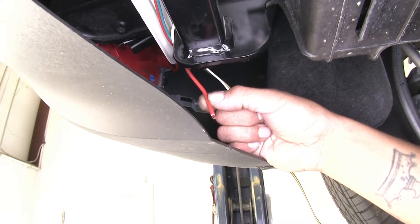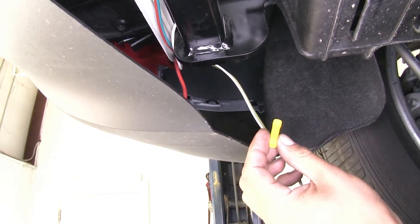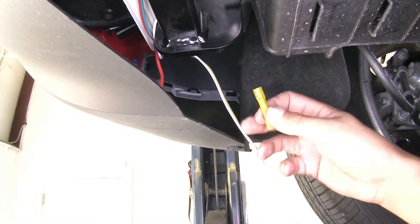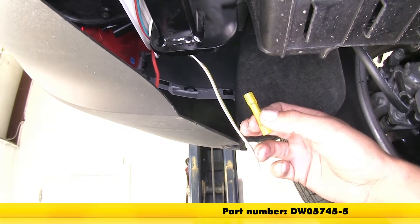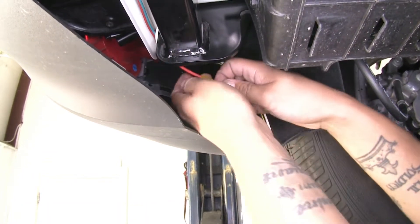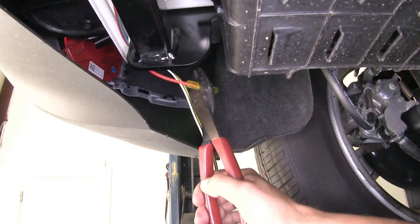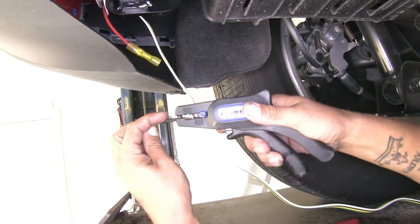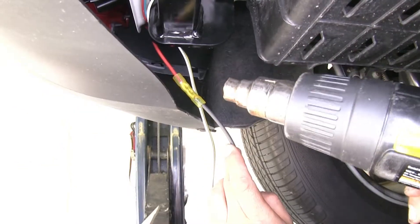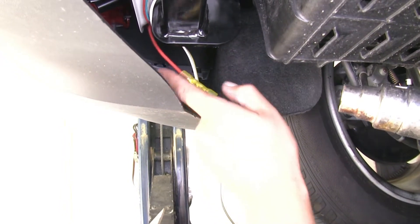We should have a red wire and our four-pole wire left. We're going to need to attach the rest of our charge wire to this red wire, and in our kit they provide some butt connectors. I'm going to be replacing them with a heat shrink butt connector for a little better protection against corrosion. You can pick some up on our website using part number DW05745-5 for a pack of five. I'll attach one end to my red wire and crimp it into place, then strip back the end of the black wire provided in the kit and attach it to the other end of the butt connector. I'm going to use a heat gun to shrink down my connector — if you are using an open flame, make sure not to char the connector or the wires themselves.